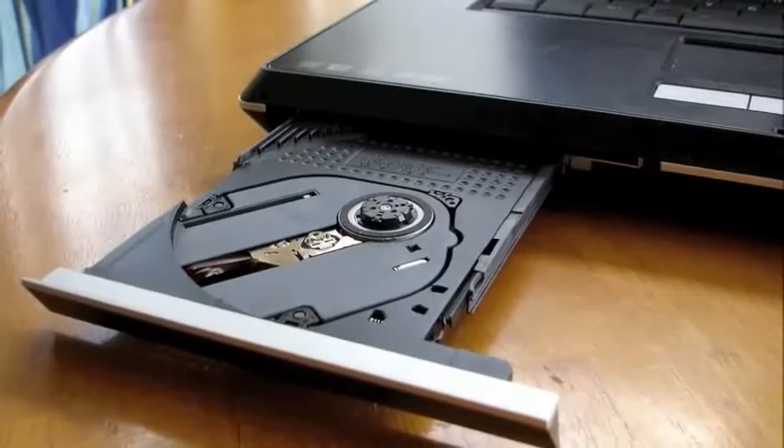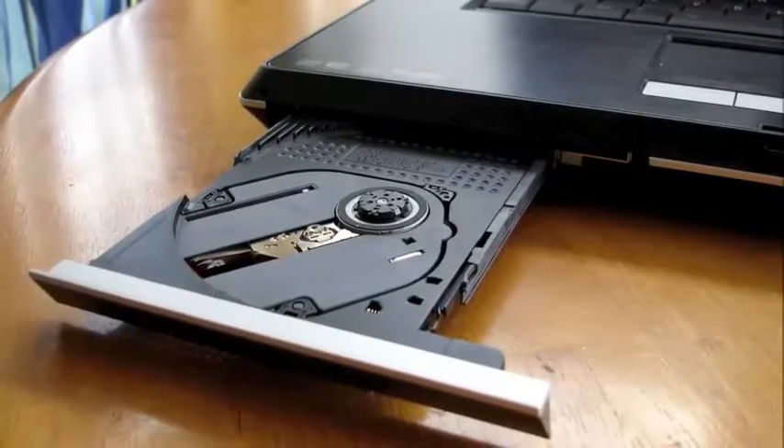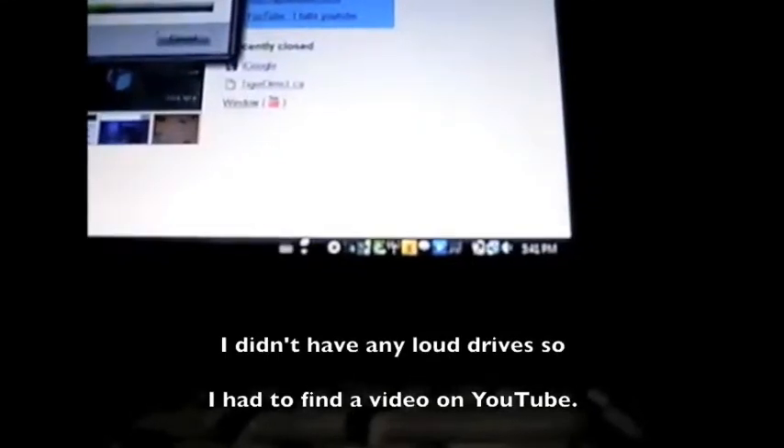CD and DVD drives. A CD or DVD drive could go bad in a laptop and needs to be replaced. Some of the symptoms of a bad drive: number one, it's loud. This could be when a disc is in or a disc is not in — maybe there's a grinding sound. I've seen drives where when you put a disc in, maybe the spindle's loose or something's not grabbing, and it just flings the CD around on the inside and makes a really loud noise that could scratch your CD.